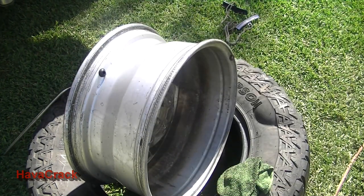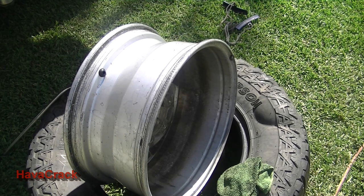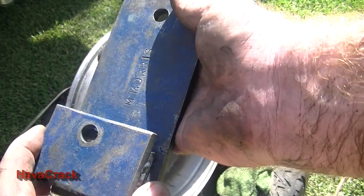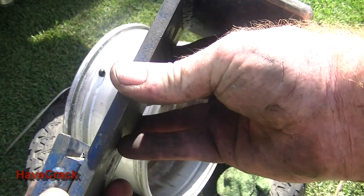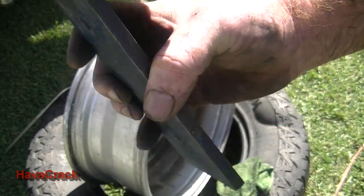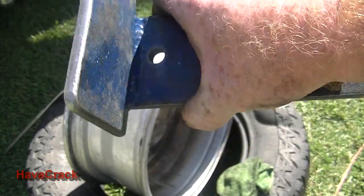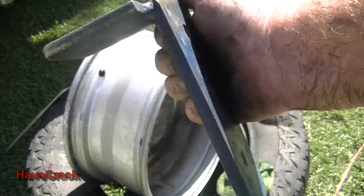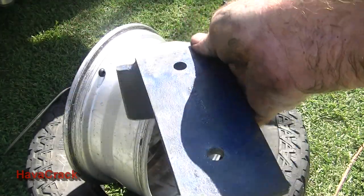We've also got an adapter that if I don't have the high lift jack on the Nissan, this bolts onto the back, it's got a recess, and that'll clip into the Nissan hydraulic jack. So I can just use that and then just put it under the retow bar as a pressure point. But that's all it is, that's the tool. And it's quite simple.